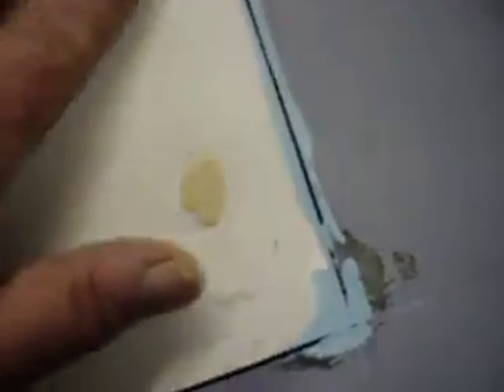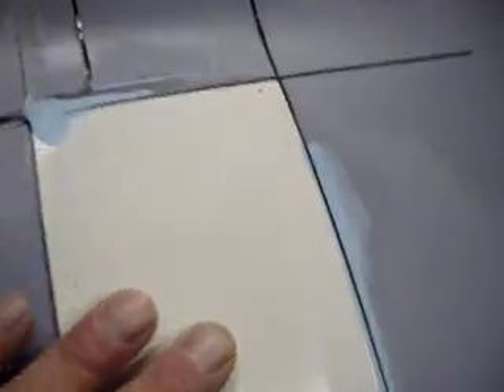I got this one already taped in there. I took some Bondo and put some more panel line tape exactly where the panel lines were. I filled it once and sanded it. Now I'm going to hit it one more time, sand it, and that'll be nice and smooth across there. Then I'll pop it out and have a nice clean line with no voids. I went along there with a screwdriver or a paint scraper so I can find any more voids. I don't want any more popping in after I get it done.